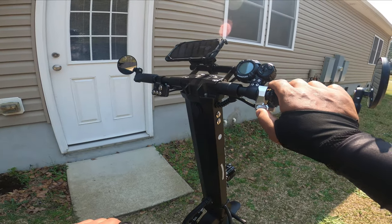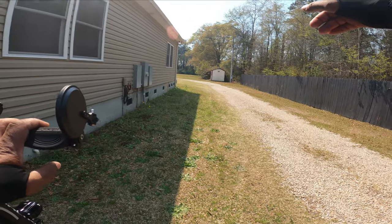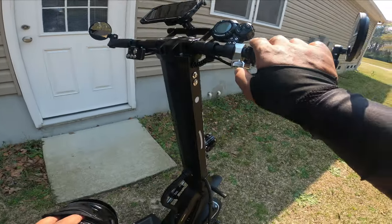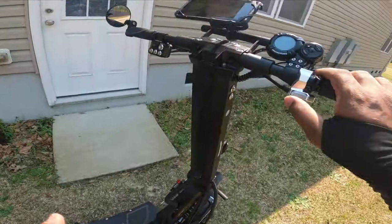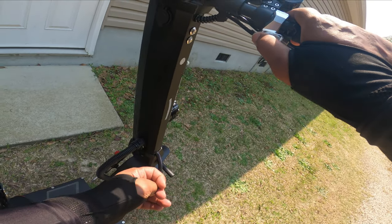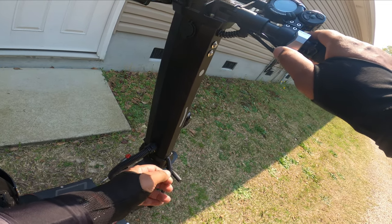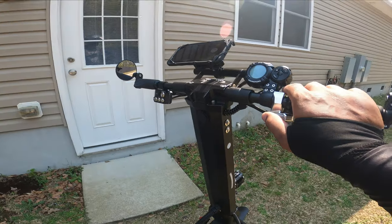So what I did is, I got a bunch of these signals on the outside of my fence here, so that I can know when someone pulls up in my yard. Well, I had some old ones in the house, and I just pulled the battery pack off of those, and I got some half-dead batteries, 4 of them, and put them in there until I equated up to about 5 volts, even with the older batteries, because newer batteries will take you over 6 volts.